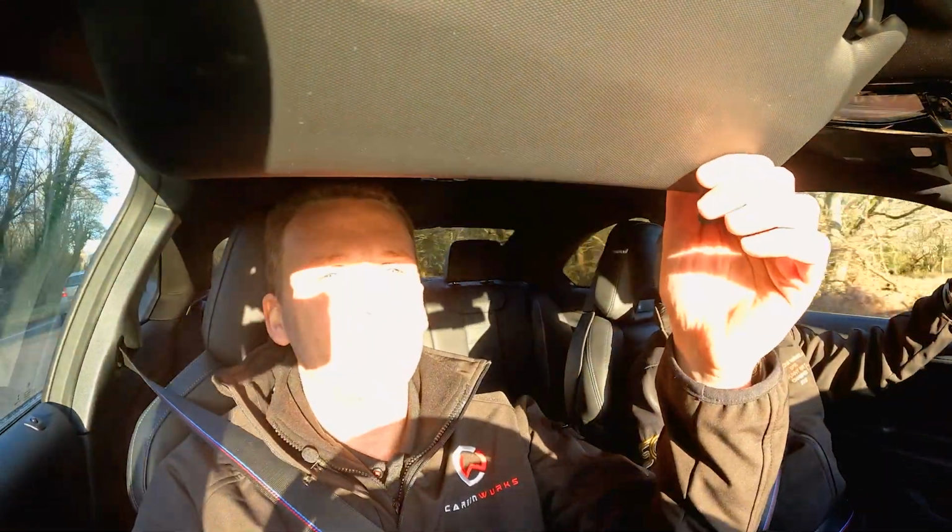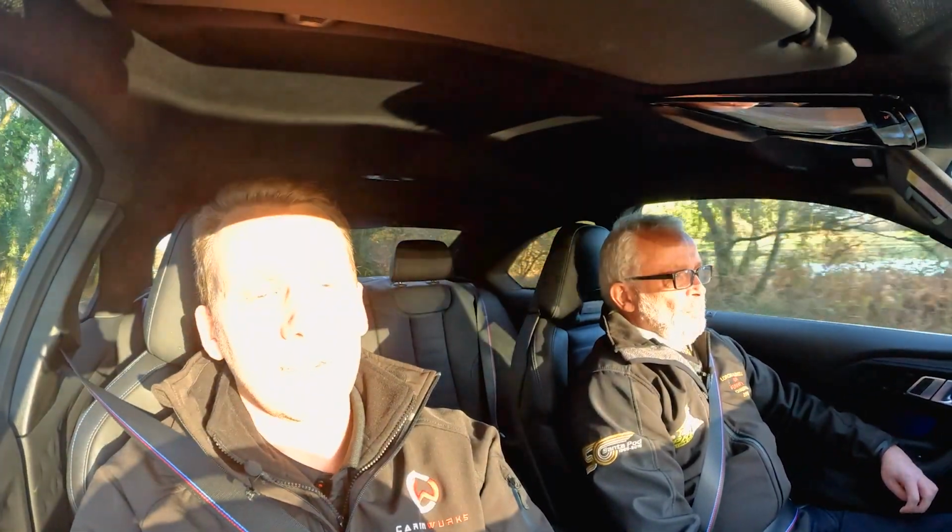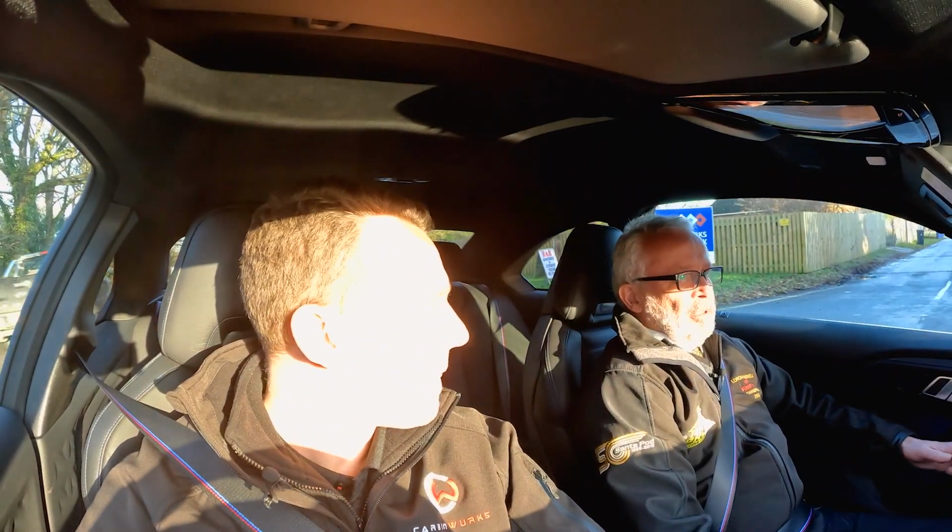It feels effortless. That feels so easy to drive, even though, as I said, that's not flat out, but that still feels really easy in seriously slippery conditions just to power through. And I think those dampers are making at least a good part of the difference in helping with stability. One of the reasons Schnitzer go with a passive damper rather than adaptive is it makes the car more predictable. So you can learn the car's behaviour better, and the car isn't constantly changing its mind about how it's going to react to a driving situation.